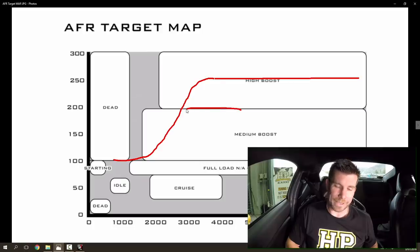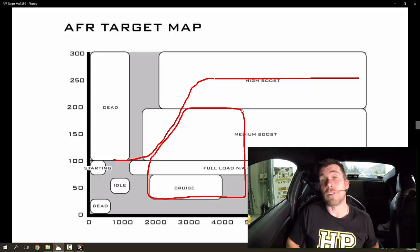So I would be focusing my energy in the region I'm just drawing here — up to around about 4500 RPM or two thirds of our engine rev limiter. But we're not going to be worrying about the very high boost areas at around 3000 to 4500 RPM. So we're going to be focusing our steady state tuning process up to around about 200 kPa. That leaves us with an untuned area, and the next step with these sorts of engines is to transition straight into doing wide open throttle ramp runs. Now that sounds a little bit scary because obviously we don't have a shape to our fuel and ignition tables at wide open throttle at these higher RPM areas.